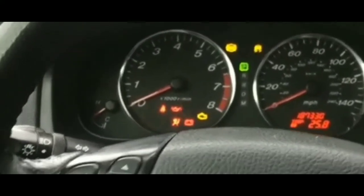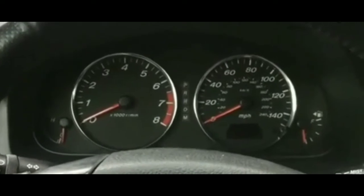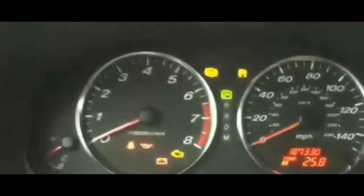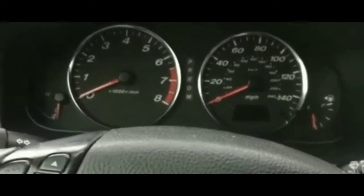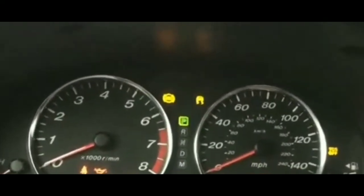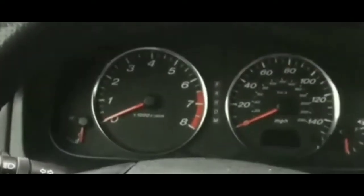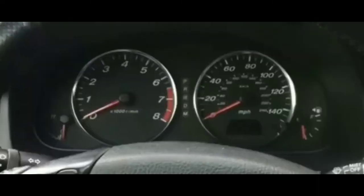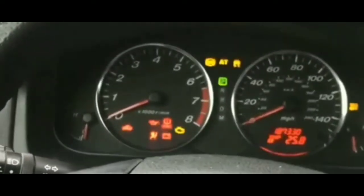So I'm stuck here, my car is not turning on, and I'm hoping it's not the starter because then I'd have to get it towed. I also considered the brake switch, but I ruled that out — the brakes work and the brake lights work. Normally if it's the brake switch the brake lights wouldn't work, so that's not the issue.